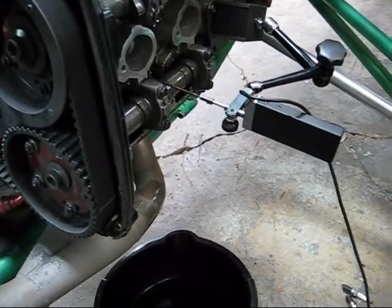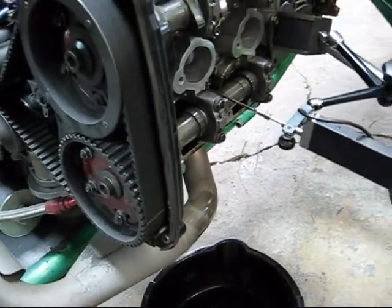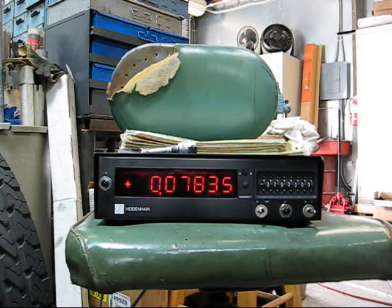Now we've set our DRO up on the exhaust. You can see it here a little better, shooting past the camshaft, got it in line with the bucket. We're going to do the same process as we did on the intake. We've already zeroed it out over the nose, so the number is going to get smaller as it gets closer to over the nose. As soon as we get to 50 thousandths — which is .050 — we will look at our degree wheel and see what we have. We're at 50 thousandths. We're at 30.5 degrees, and we'll convert that over — that will actually be 149.5 degrees.